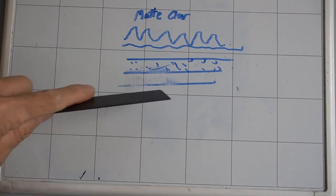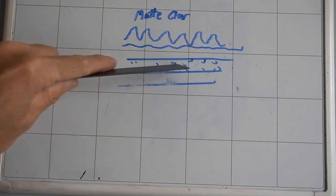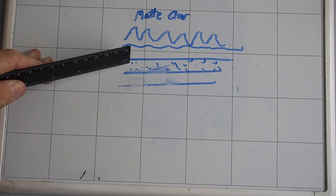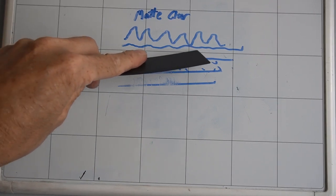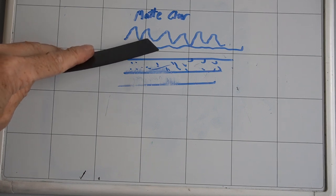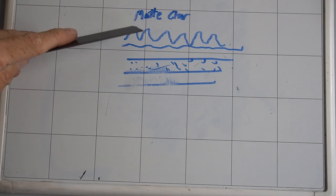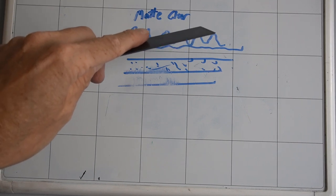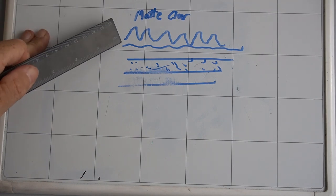And if this is your panel, you'll have the primer, base coat, and then a clear coat that has no sheen to it whatsoever. If you look at regular clear coat microscopically, it is like hills and valleys. To give you a matte or satin or a stealth finish, if you look at it sideways microscopically, you're going to see deep peaks and valleys, and that takes away the sheen from the surface of the vehicle.